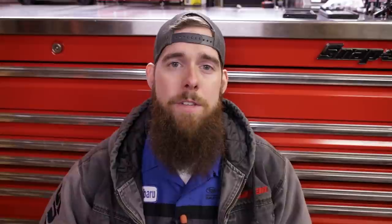On your Subaru vehicle, you could have a variable number of oxygen sensors. The majority of Subaru vehicles will have a minimum of two sensors — one at the front and one at the rear, commonly known as upstream and downstream sensors. Your upstream sensor is normally located in your exhaust manifold, closer to the engine, and is used by the PCM to calculate your fuel-air ratio. The downstream sensor is normally located in or beyond the catalytic converter, and the ECM uses its data to calculate the efficiency at which your catalytic converter is working. These sensors are different and not interchangeable, so make sure you get the proper sensor for the proper location.